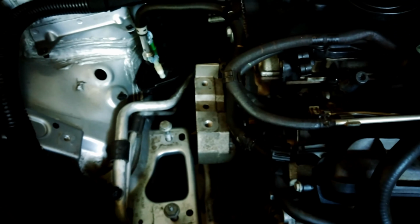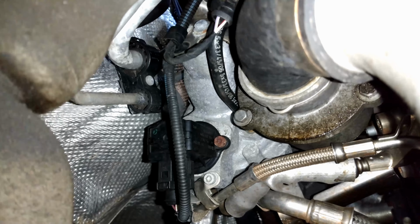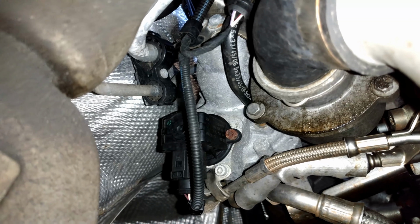Both the ECS tuning document and the other DIY I have do not mention this step. There was one video I found on YouTube, I think I'll try to link that in the description as well, where what they did is that they unclipped these AC lines so that you can move the AC lines upward, and that would then allow you to get this out, basically. And there's two different attachments that look like are holding these from being raised up. First is this Torx nut down here. I'm going to see if I can loosen that and see if that'll give me any clearance. See that black clip there? It's right above that electrical connector. That black clip, basically, they loosened, which allowed for them to raise up the AC lines.